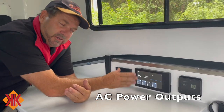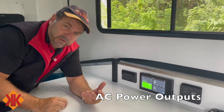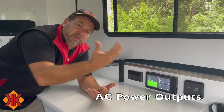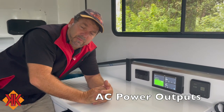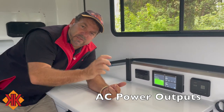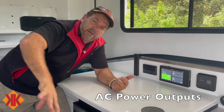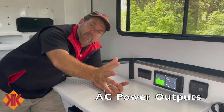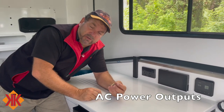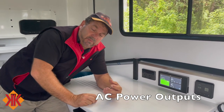Moving to the output screen on the 48-volt console: on the AC side, there's an automatic changeover when you plug into shore power — some power charges the battery through the charger, running the DC side, while the rest bypasses to run your GPOs and air conditioner directly. You're not running everything through the battery. There's also the inverter output.